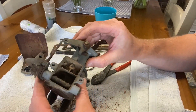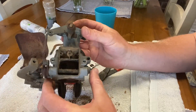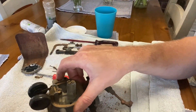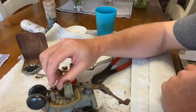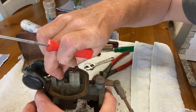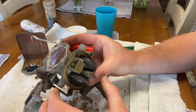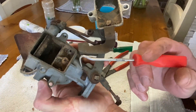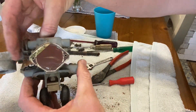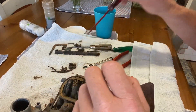It's a very simple carby - throttle at one end, choke in the middle without the wasp nest. I've got the needle. The floats look pretty good. This valve here goes up and down - sounds good. So I'm going to pull these two out, make sure they're clean - I've got some carby cleaner. I need to put that end cap back on first. It might seem a bit silly to try to protect that bit, but it's probably the one piece I'm worried about.